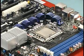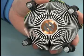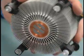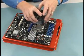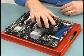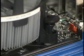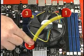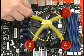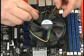With the processor installed, the fan heatsink can be installed. The fan heatsink comes with thermal grease, or TIM, already in place. Lower the fan heatsink straight down over the processor and socket, lining up the locking posts with the holes in the motherboard. Using a criss-cross pattern, push down on the caps until they click in place.